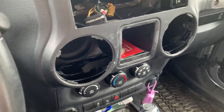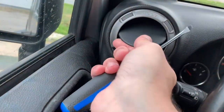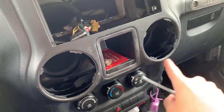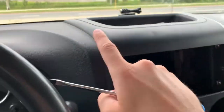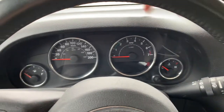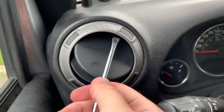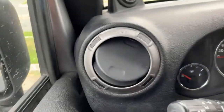As long as you don't end up putting the screwdriver up into it and pushing from the bottom, you'll be fine. Most people don't think they have to take this one out because it looks like it should all come off in one nice piece — unfortunately that's not the case. The dash here is connected all the way around, and it'll disconnect from about right here and you'll have to lift the whole top part off with the instrument cluster exposed.